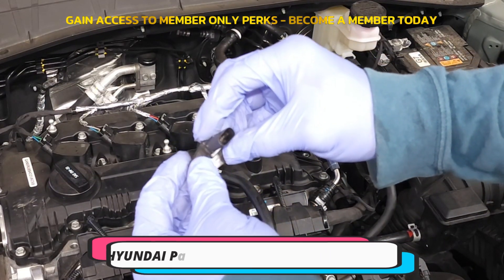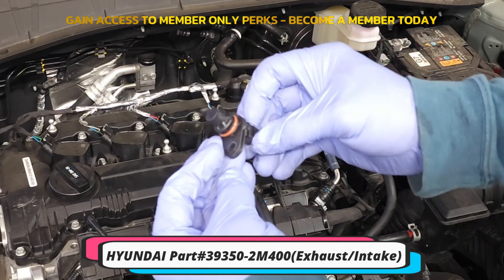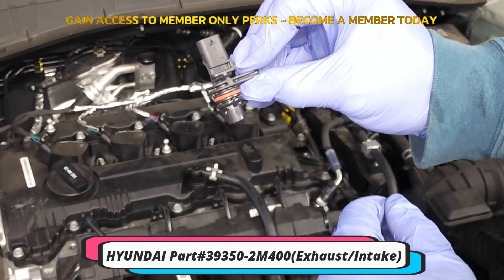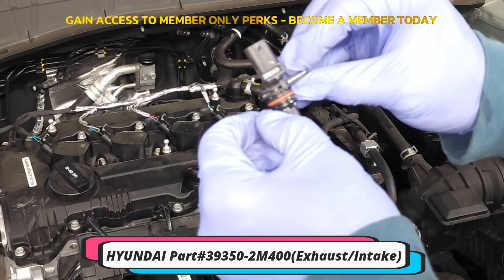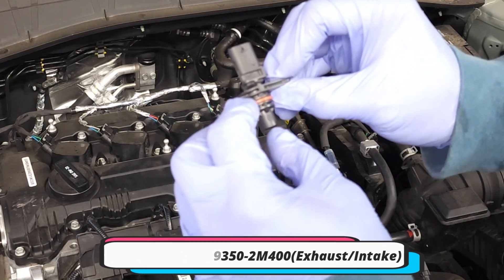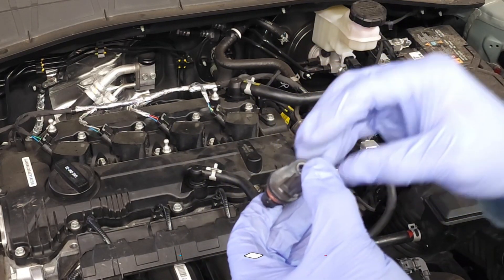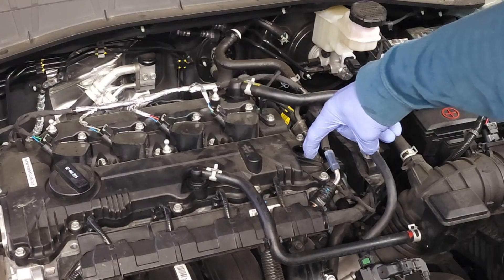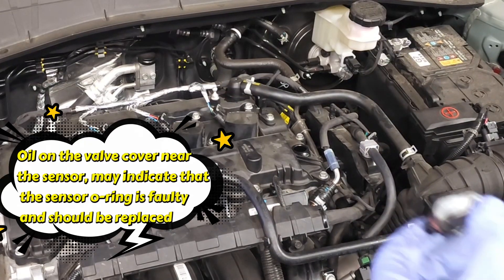Let's go ahead and inspect it. There are three electrical leads there. I don't see any cracks, just working from the top down. You'll notice that the area above the O-ring is very dry, and that's exactly what you want to see. The O-ring is very pliable — poke at it with your thumb. It shouldn't be dry or brittle, and this one isn't. At the same time, go look at your valve cover and see if there's any oil around the camshaft position sensor location — this one's completely dry as it should be.